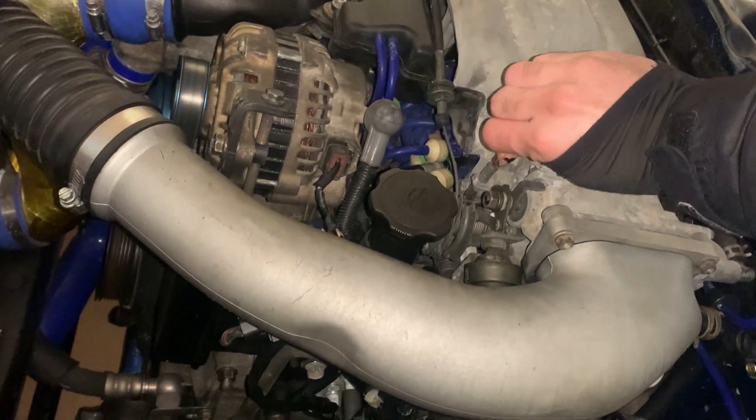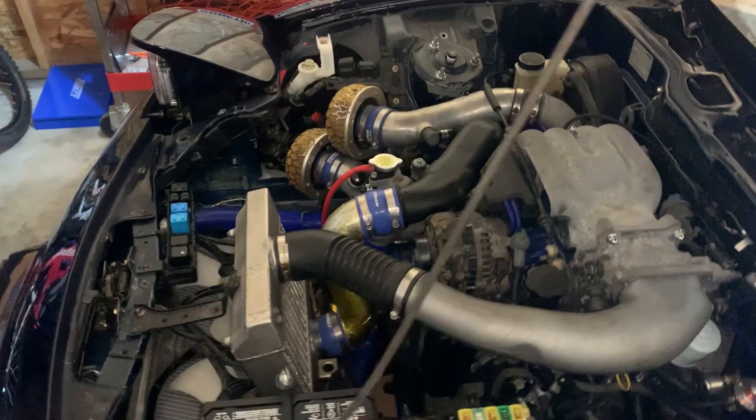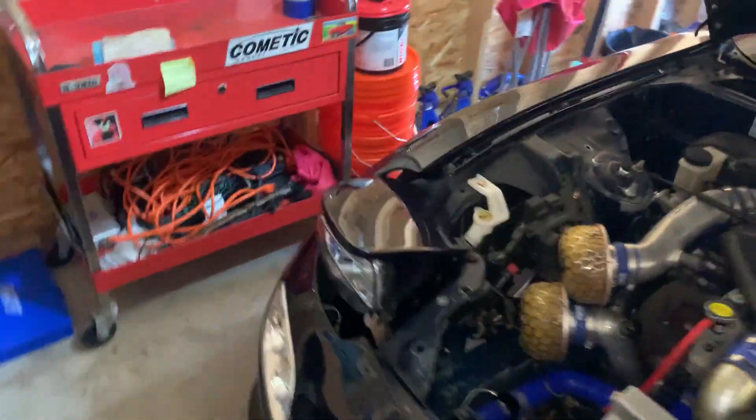It is idling — this is too high for idle, and you can hear it's still popping a bit, possibly a little bit of a misfire. Hear the popping in the exhaust? There's a stumble there. We did confirm it's somewhat of an issue. Maybe if we close the hood everything will just be fixed. AFRs are better with the hood closed.